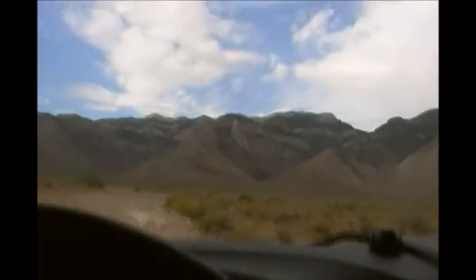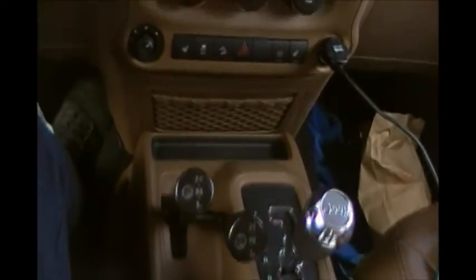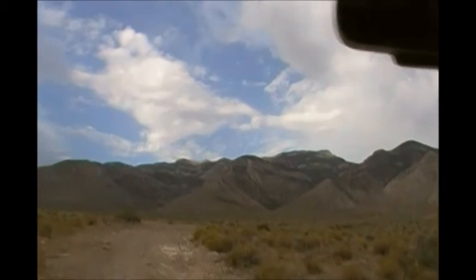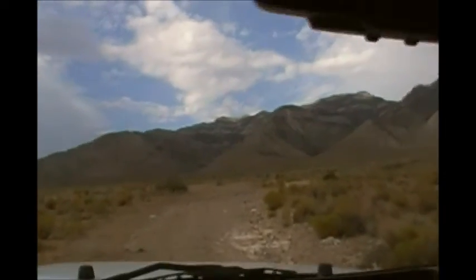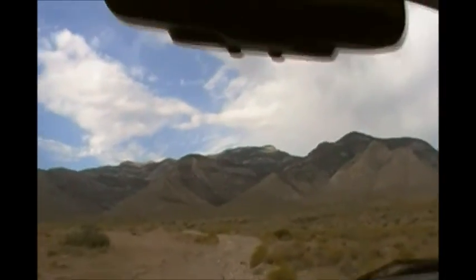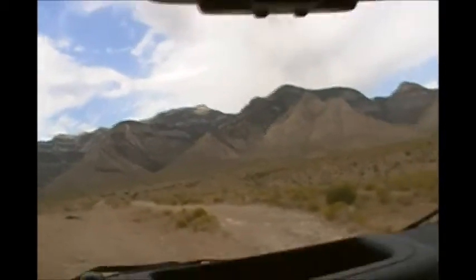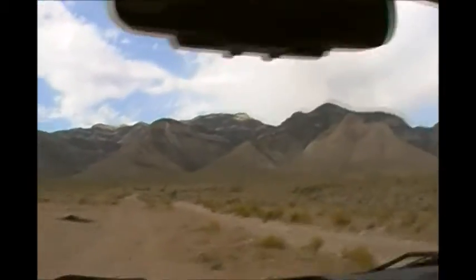Alright. We're going to go into 4-wheel drive low here. Alright. We are now in 4-wheel drive low. You can see our warning lights, ESP, ESC off, came up. If you got a 4-to-1 transfer case, with an LS, you might want to invest in some big brakes. We can support different shift patterns in four-wheel drive low, but I highly recommend you just stay with a stock pattern. It works really well.